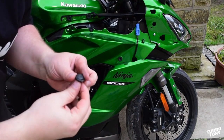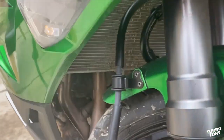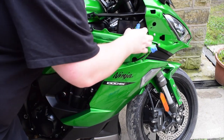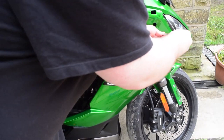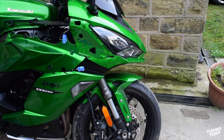Under the fairing there are pop rivets — just grab them and pull them and they should pull out, quite easy. There are also two pop rivets under the front of the bike — one just there where my finger is, another just in front of it. We need to take those out. Then I'm going to disconnect this connection — just push it in and pull, that's it, disconnected. There's also another two allen key bolts here — four millimeter — we'll take those out.